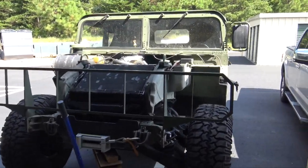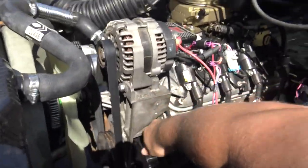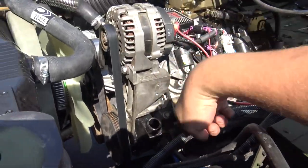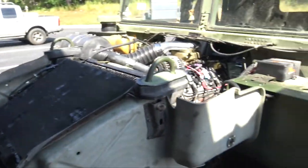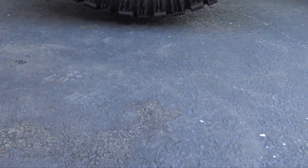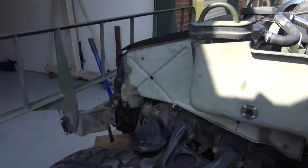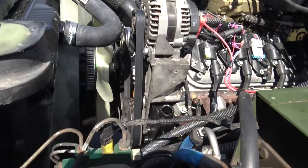Now what we're looking at doing is bleeding out the hydraulic system. In this LS swap, this hydraulic hose right here had to be extended to the pump, and when they did that a lot of air got in the system and it squeals real loud. If you've never bled one of these, you jack the front tires off the ground and you literally just press the brake real slow, going back and forth with the steering wheel real slow, lock to lock — about 40 to 50 times — and that should get all the air bubbles out.